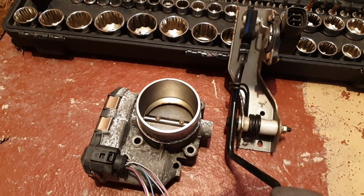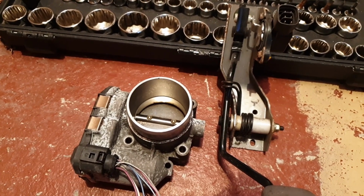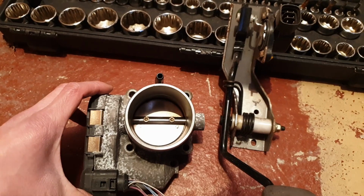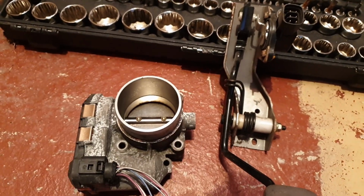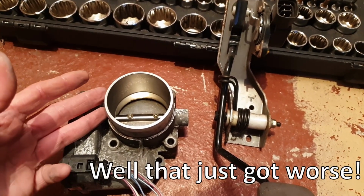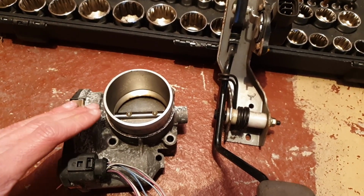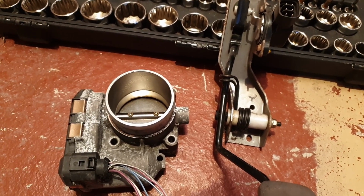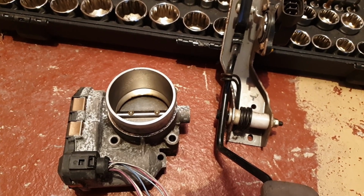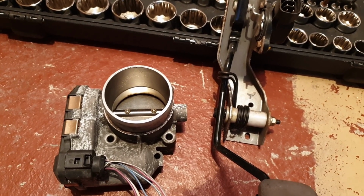So you have very limited movement in the throttle before you're starting to let quite a lot of air in, and that means that if you're driving in town or you're driving a street car, it becomes very difficult to actually manage the power. Whereas with a drive-by-wire system, I can actually tell the ECU that unless I'm pressing the throttle 50% of the way down, then I don't want the throttle to let 50% of the air in. And notice I say 50% of the air because it's not linear. 50% opening of the throttle doesn't necessarily mean that you're getting 50% of the amount of air that the engine can take. You might be getting 75%, and obviously that means that the remaining 50% of the pedal travel is only covering 25% of your power range.